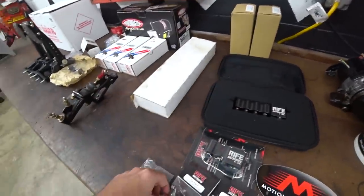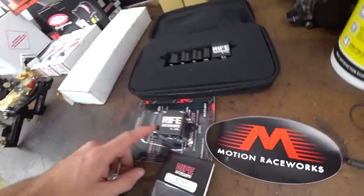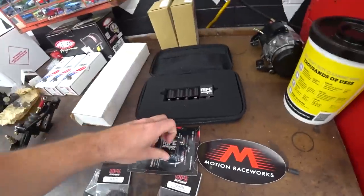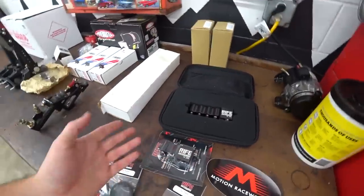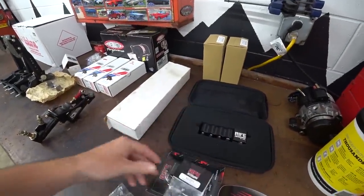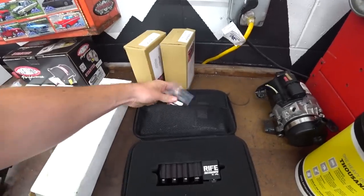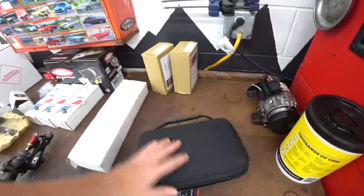We've got two temp sensors that are going to plug in with M5 cables to our two-sensor block. Since it has a six-pin connector and we only have two sensors, we can add two more for a total of four. We also have 1/8 MPT temp sensors, so we're going to be monitoring all the things — fuel temp, coolant pressure, crankcase pressure, back pressure in the turbo system.